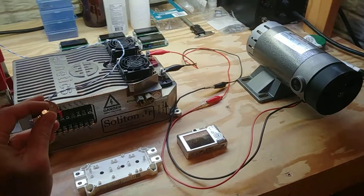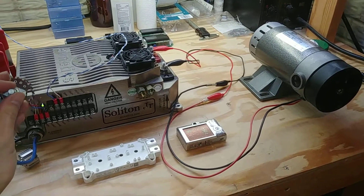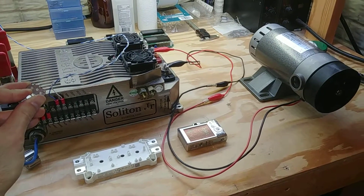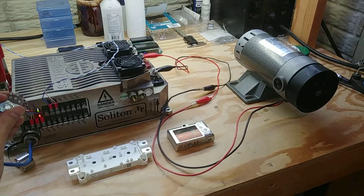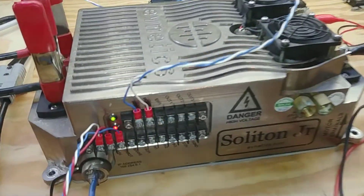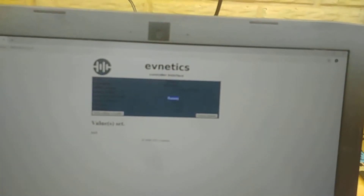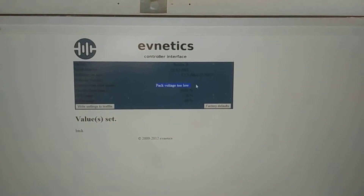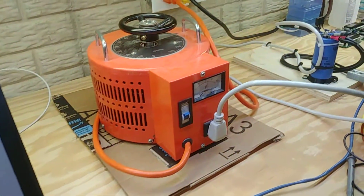Got the motor in frame. We're going to increase the throttle here slowly. And that was it — we kicked out. You can see we've got an error message now. The motor spun a little bit and then that was it. Refreshing the website, we now have an error message that says our pack voltage is too low. Well, that's really odd, because we're powered off the wall.